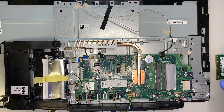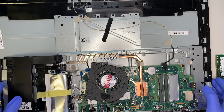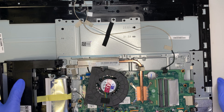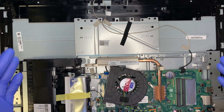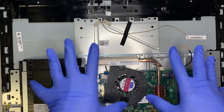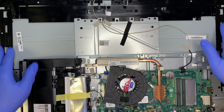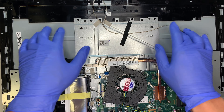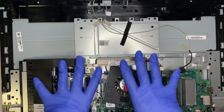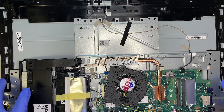Now if you're talking about removing or replacing the LCD screen, this can be a bit tricky. The way they built it — I believe it's similar to one of my videos on the HP all-in-one — you would have to transfer everything like the motherboard, take apart the frame, and just replace the entire LCD. The process is quite simple: take things apart, remove the black frame, and replace with the new LCD.